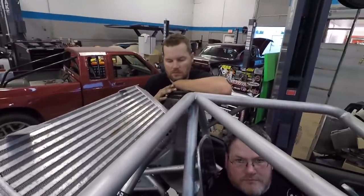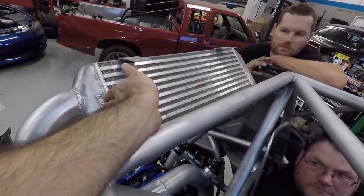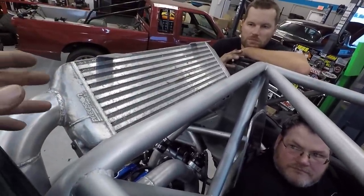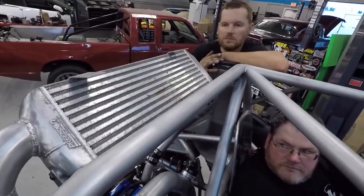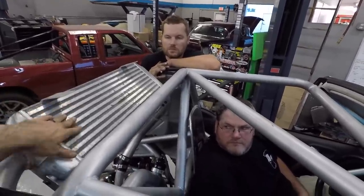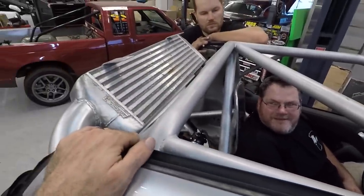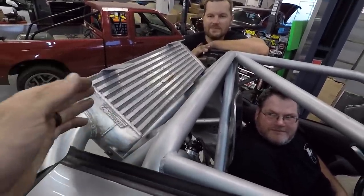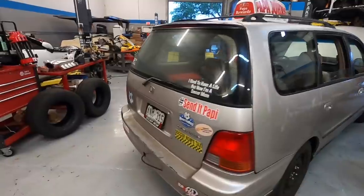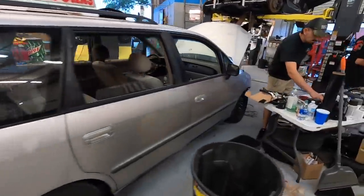If you think about it, if we're just scooping from here, for one, that's going to look a little funny. If we open this up to traverse the whole car, we're now potentially getting in maybe 15 or 20% more airflow that we're funneling in. So we want this thing to be able to perform at speed and really have a super, super efficient intercooler. Laz knows we do all this type of crap with CTSVs plenty of times. Any little low-hanging fruit, something that we can optimize and make more efficient, we're doing it. To you guys that don't know the Boosted Boys, it's not just another soccer mom.